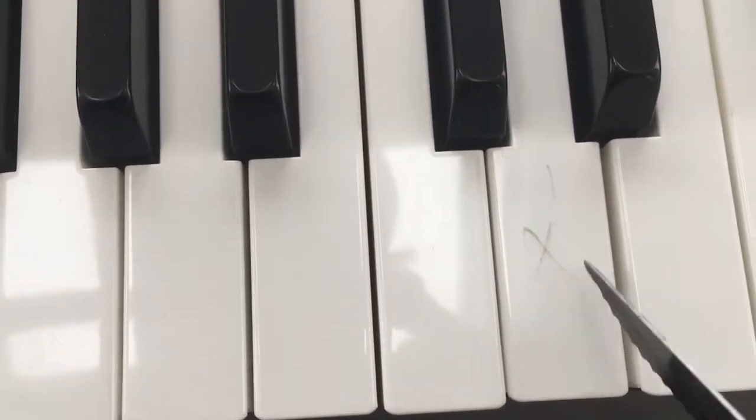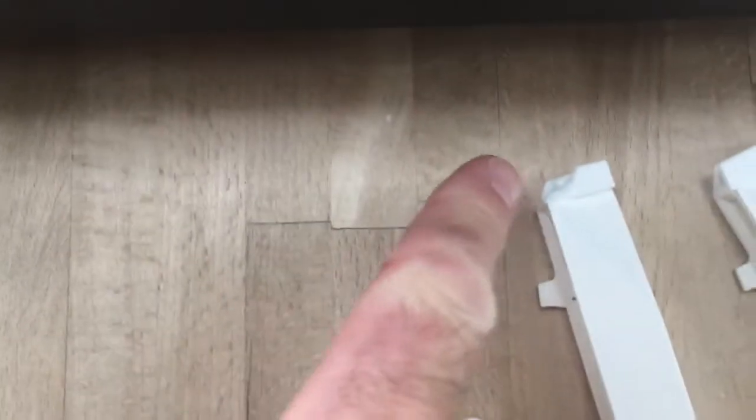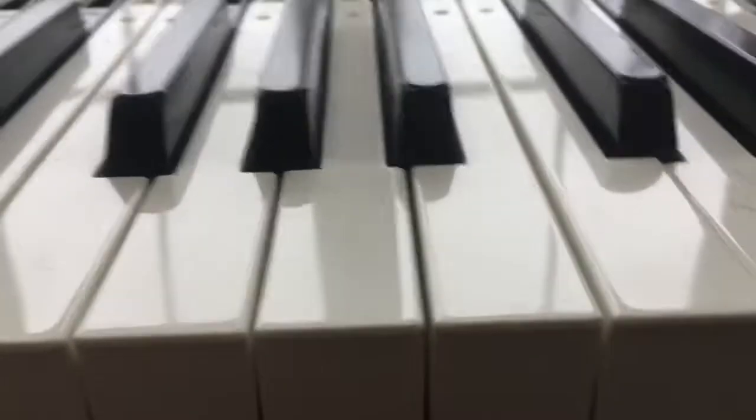I've marked it with a pencil already so I know it's one of the bad ones. When they go bad, at the end of the key there is a little piece of plastic which either breaks off completely or cracks and bends slightly. If it's cracked and bent slightly you might not see it, but that is the problem with the keyboard if there's a key sticking down. You can see this key sits obviously down a bit, but it also sits slightly crooked — the top left is closer to the key on the left and the top right is farther away from the key on the right. This is because when this piece breaks, the key tilts, and even if it's only a small crack the key will still tilt.